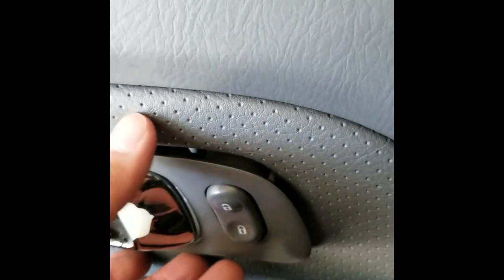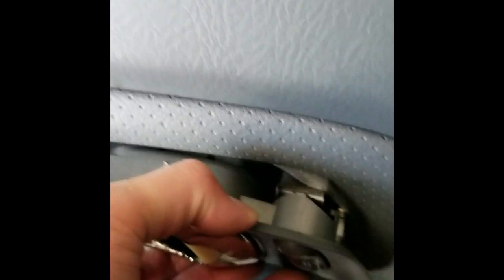After removing the window switch, I have one screw here — I hope that's the only one, but we'll see. Here's the door handle, and I figured out that this part right here acts almost like a hook behind it. So it was like this — tilt this forward and then pull it up a little bit and slice it out. Now it's loose.